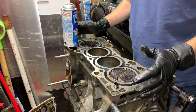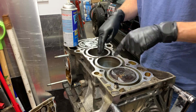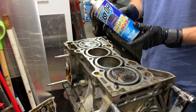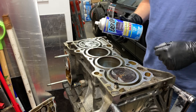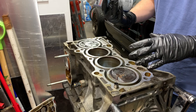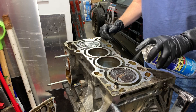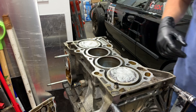I got the motor turned over and got these two pistons up — the clean ones are now down. I stuck some rags in here just to keep any debris from falling on the clean ones. We're going to spray a coat of oven cleaner, let it sit for about three minutes, then start agitating with the brush, doing one at a time. Make sure you have gloves on — this stuff is extremely hard on your skin, it's a lye base and will actually burn you. Make sure you have old clothing and eye protection on as well.